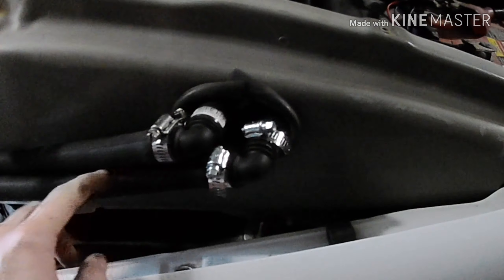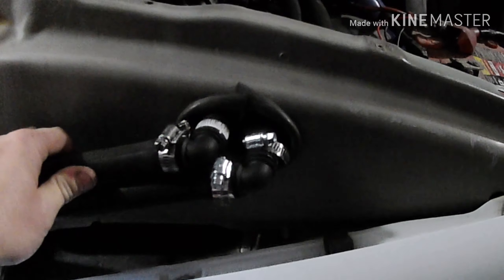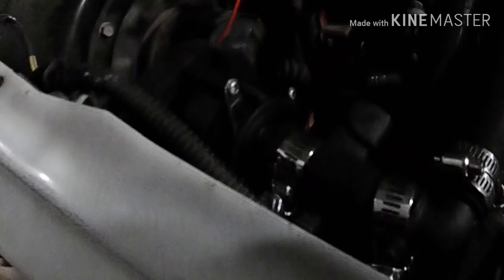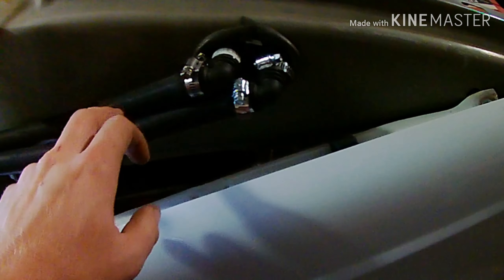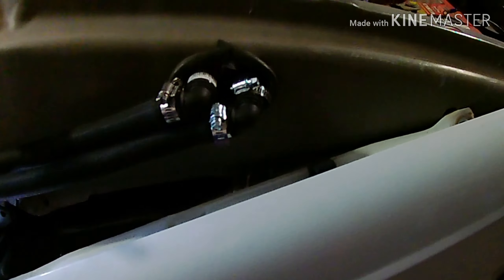With the pump where it is, I was getting a little suction that cavitated the pump and it wasn't functioning. I've got the unit running — it heats up great, heats up so hot you can hear the water bubbling and boiling — because I'm not getting the water flow I should through there. I'm going to run the pump side down lower with the pump low, and we'll get it figured out that way.